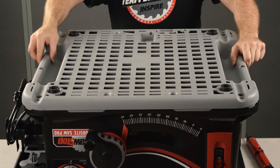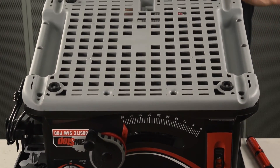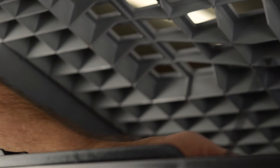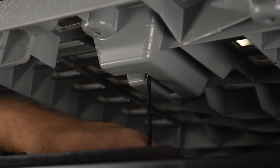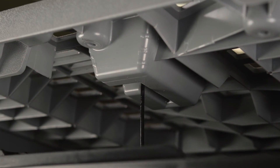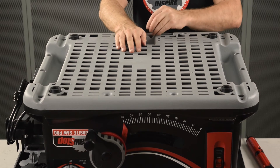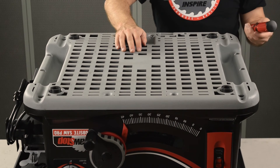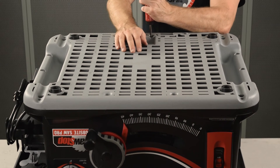Next, seat the cabinet base on the cabinet. Tilt the cabinet base just enough so you can access the counterbalance spring. Pivot and hold the spring so it is pointing up. The end of the spring fits into the indentation inside the cabinet base. Align the spring and indentation as you lower the base onto the cabinet. Press the base down and hold. Reinstall the cabinet base screws, starting with the screw closest to the indentation. Do not over-tighten the screws — if using a power driver, make sure the torque is set to no more than mid-range to avoid stripping the screws.